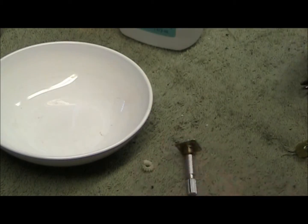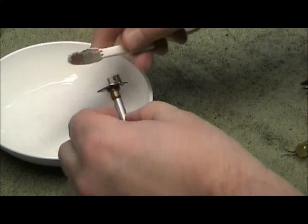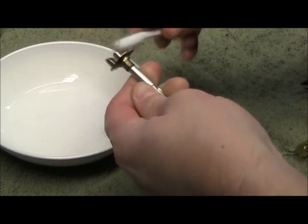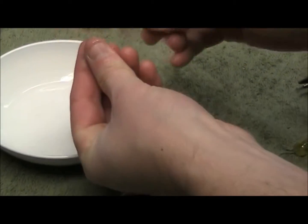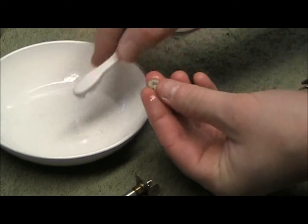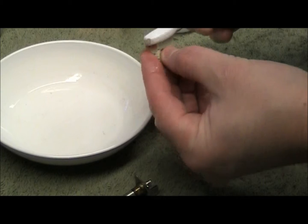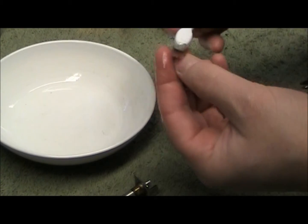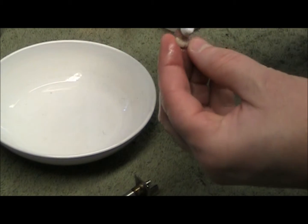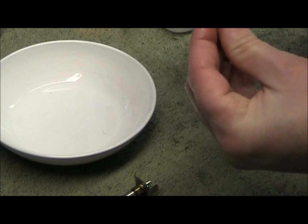The gear and the knob have oil or grease to keep the gear lubricated. I'm going to use a little bit of isopropyl alcohol and clean these, so that way my epoxy will attach and adhere — because that's what I'm going to do, I'm going to epoxy this on. We've got to get all the original gear grease off of this thing. You can really see the crack once this thing's been cleaned. This is obviously the missing link — if somebody can get a gear made, they can sell that on eBay.